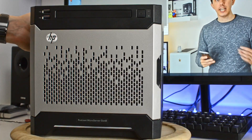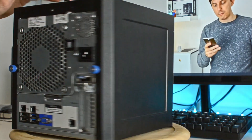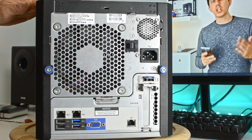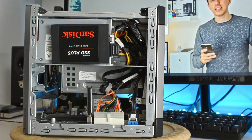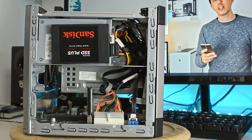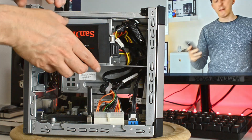This is the 8th generation of the HP MicroServer — a fairly old version of the ProLiant series from HP. I bought it secondhand. The previous owner already had an SSD drive in the server, but actually strapped it with a Velcro strap next to the PSU. It was not done in a bad way, but I was not cool with having the SSD sitting on the power supply due to electromagnetic interference and heat.